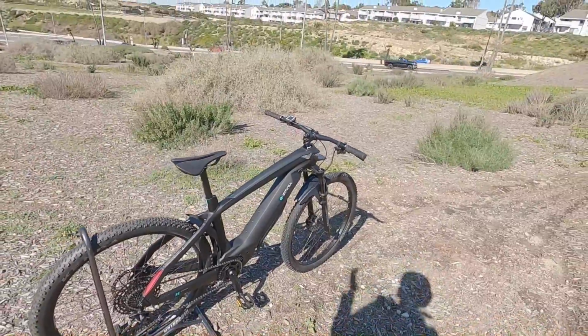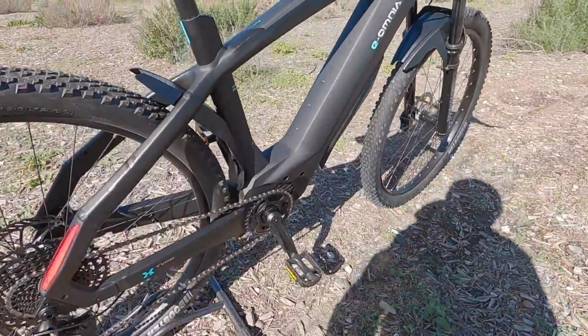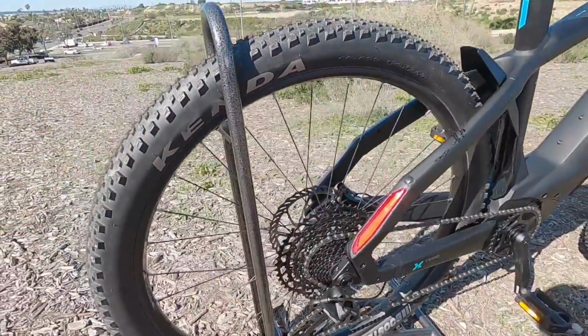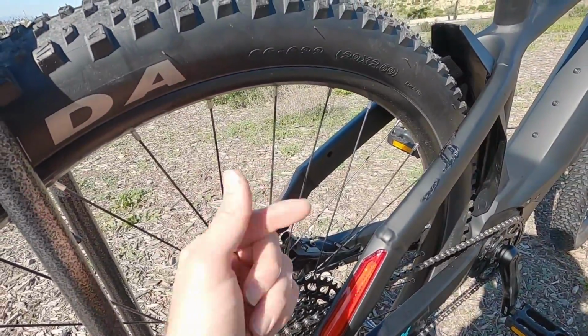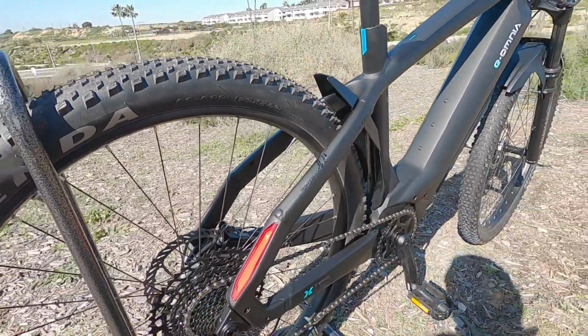Thankfully, this is using Bosch e-bike systems, and it's got shift detection. So over 1,000 times per second, the motor controller is measuring pedal cadence, pedal torque, and rear wheel speed. And the rear wheel speed magnet is mounted to the hub on the other side, so it's really tucked away. It's not a magnet that's on the spoke that could get bumped out of place or get dirty. Really appreciate that. It's really tight. One of the best systems around.